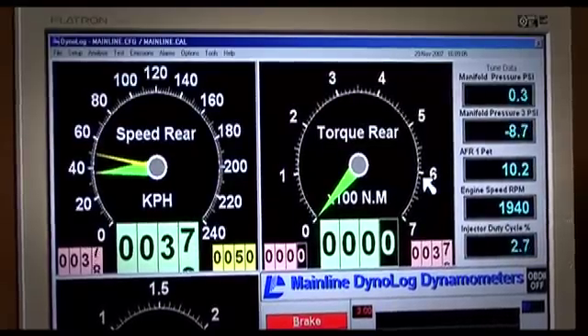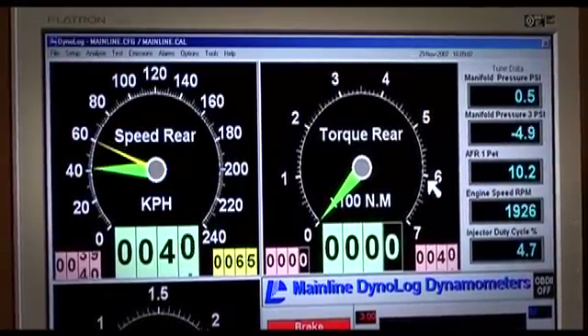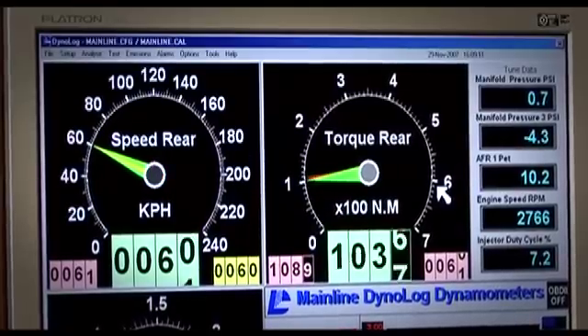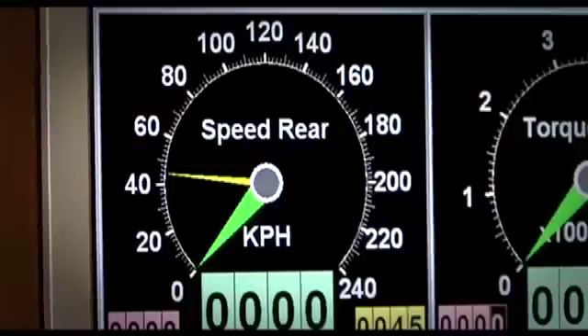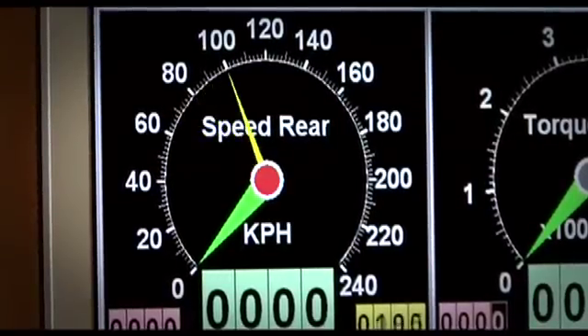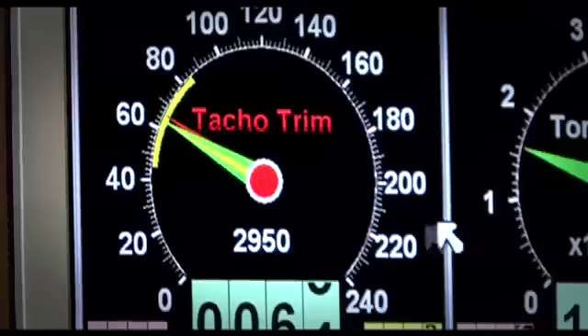On the main screen, the road speed and RPM control mode have fine adjustments that hold the engine at a fixed RPM or speed, regardless of throttle position. This function, along with all the available data, makes tuning a breeze. Tuning the car is simply a matter of changing the RPM or speed points along with throttle settings so you can reach all parts of the fuel and ignition map.